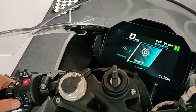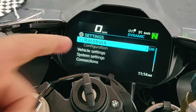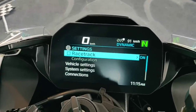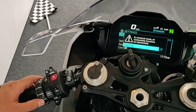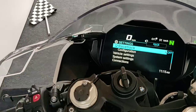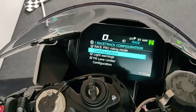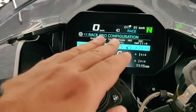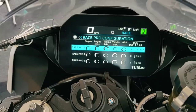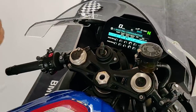The Settings menu is where you have the most functions — press the menu button at the bottom to enter it. The racetrack mode needs to be turned on to access Race Pro: flip the ring to the right, rotate it a little, and flip it again. Once in configuration, you have individual control over engine, engine braking, traction control, wheelie, ABS, and DDC — dynamic damping control. This motorcycle has electronically controlled damping for both the front forks and rear suspension.